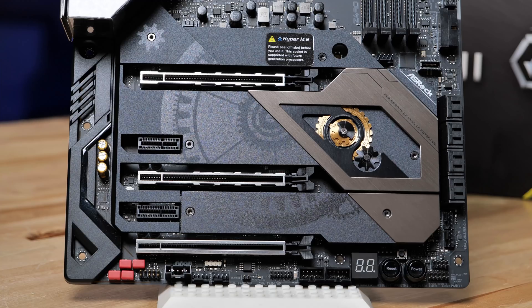It's only when you're super overclocked and doing really insane things that you need the cooling capacity of a 360-millimeter radiator custom loop. Three physical by-16 slots: two of those run directly to the CPU in a by-8 by-8 configuration, and the other one is connected to the chipset.